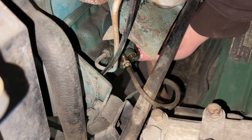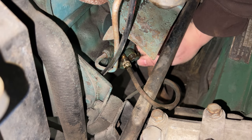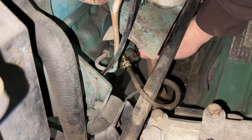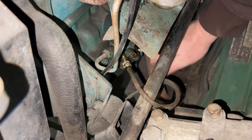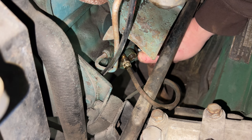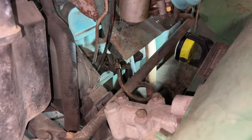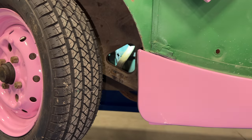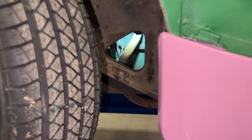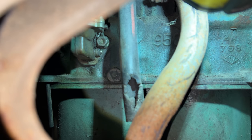This fuel pump is the original one, and there's a lever right here so you can manually prime it. It's all gummed up — I think the lever may have just broke. So this pump is going to need to come off so that I can replace it. Getting to the front fuel pump bolt can be done easily through the engine bay, and getting to the rear one can be done through the footwell.